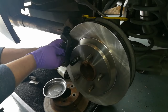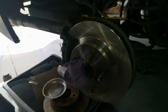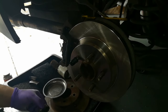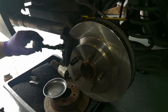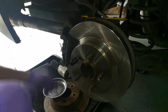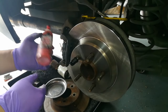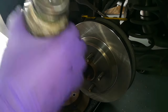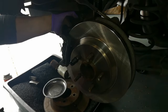To give the caliper the best chance of sitting in there correctly, go ahead and squeeze the pads on there so they're nice and even. The last thing to do is apply a little tiny bit of caliper grease anywhere the piston or caliper is going to touch. I've already applied the back side earlier — now I'm going to do these right here where the two arms are going to touch. They also make other anti-squeal products; I'll have a link to everything in the description box below. This works really well and is sometimes my preferred method if a vehicle has a constant squeak.